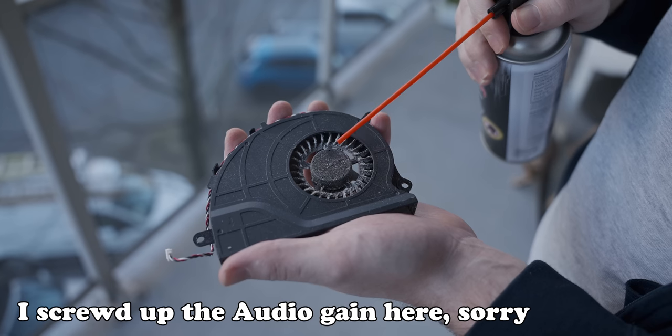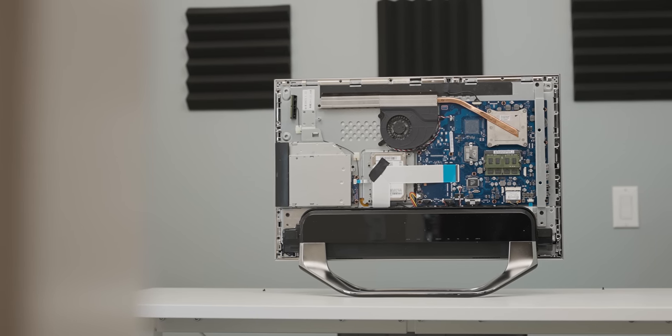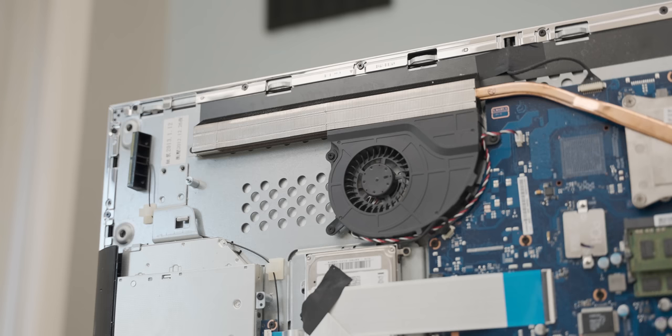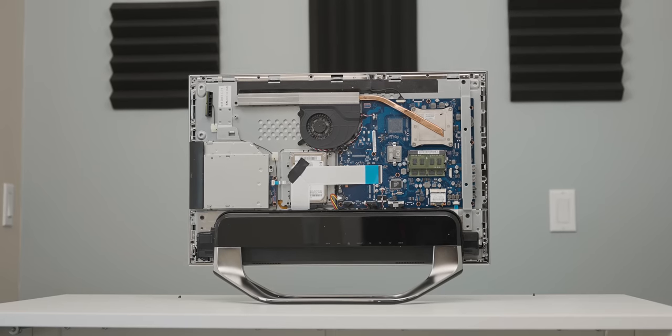After all of that, I cleaned out the heatsink, the fan, repasted the CPU, and put it all back together. We got more than 10 degrees Celsius lower temperatures on the CPU while running Cinebench, which is pretty cool. Unfortunately, it didn't lead to any performance improvement, which is a bit of a shame — but it shows that there's headroom in that cooling solution. So let me know if you want me to do a follow-up video where I strap electrodes to its face, slowly increasing the voltage until it loses consciousness — by that I mean just drop a high-end CPU in there with an external GPU dock and try and get the most gaming performance possible out of it. Thank you very much for watching — if you liked the video, like and subscribe to the channel for more videos like this one. Until the next one, bye-bye.